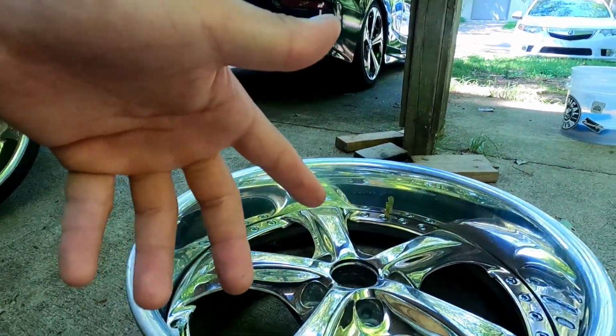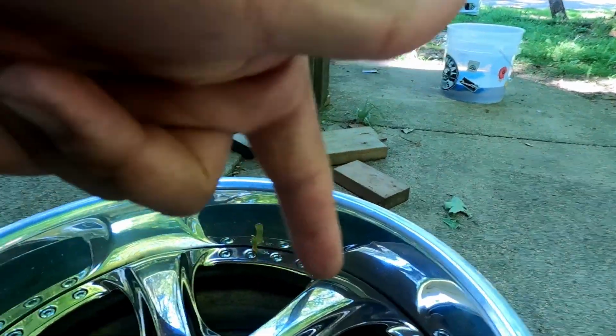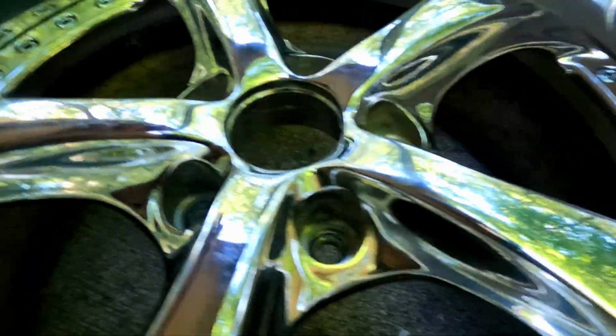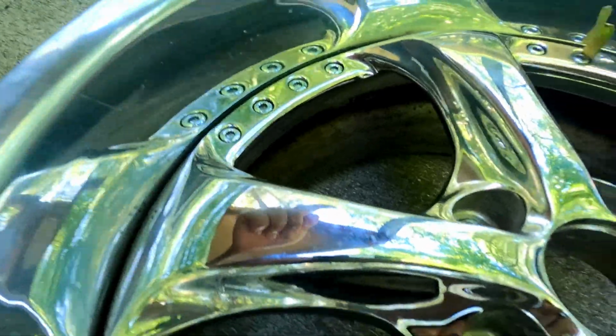Before you start rebuilding these wheels or any 3-piece wheels, please hit them with some PB Blaster, like WD-40 or whatever can break free rusty nuts. Or if wheels are new, don't worry about it, but if they're old like these are, use some PB, bro, trust me. Save yourself the headache. I got lucky with these ones, so I got 1, 2, I took that one out, 3, I think 4 in total bolts were stripped.